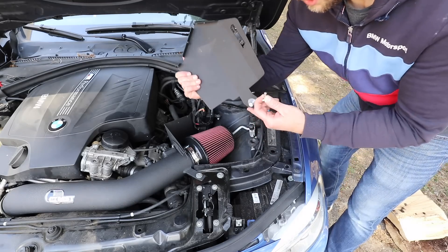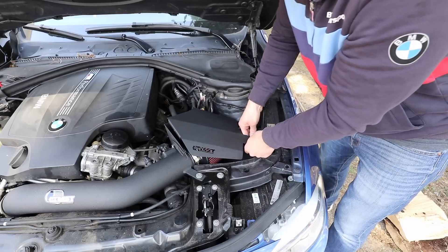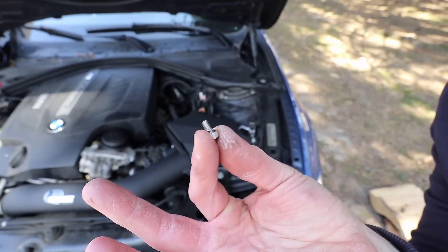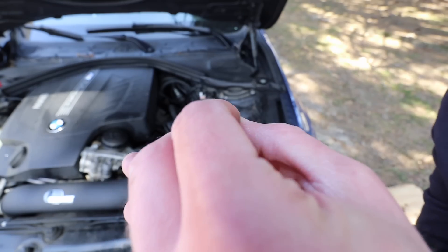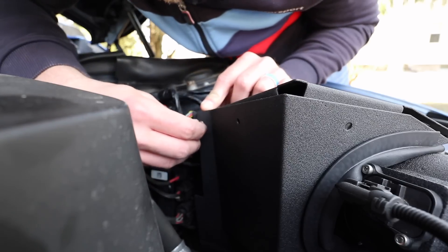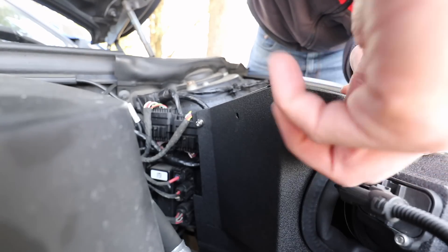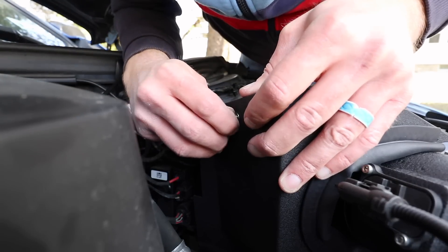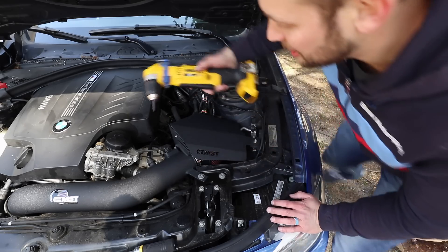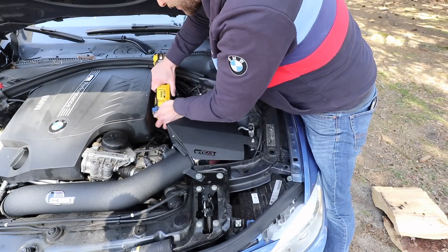The grommets are right over here. Take the metal piece and press it into place. Line up the shield so the metal piece is on the inside. Take the small bolt, put a locking washer then a regular washer on it, and screw it in from the outside in — line it up and screw it into place. Repeat for all three holes. If you forget your 3mm allen key, you can also use a T15 since it's the same size — just go slowly so you don't mess up your bit.